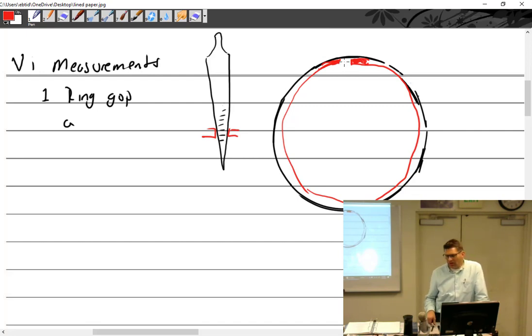There's a minimum and a maximum for ring gap. If the gap is too big, you get blow-by and loose compression - or too much or not enough oil depending on which ring it is. If the gap is too small, especially with choke bore cylinders, as the ring goes down to the choke the gap gets smaller and smaller until it breaks the ring. So you have to be careful where you measure the gap exactly.